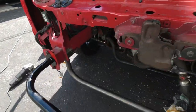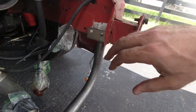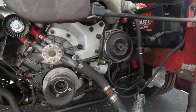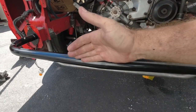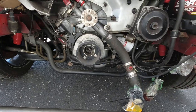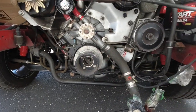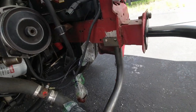All right, we have the bar sitting in here — got it all the way up over here and over here. I've taken the measurements with the radiator and it fits. I also went ahead and put a level across this bar and this one here to make sure all three were sitting at the exact same angle so everything was kind of true, and took a couple of cross measurements. I still have to take it off again to clean up and do some welding, which brings me to an interesting point. It seemed like a great idea getting a chromoly bar — lightweight, saves some weight off the car — but then it occurred to me I've never actually welded chromoly.